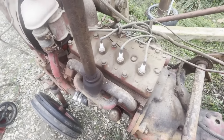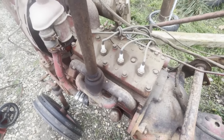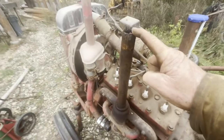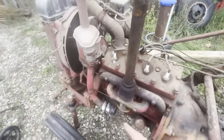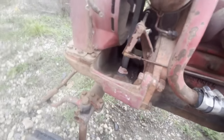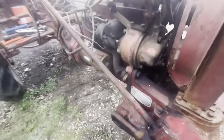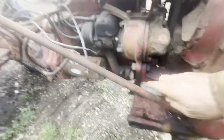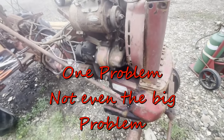She's got a cracked head right here. Well, that's too bad. I don't know if we can repair that or get a different one. That's why we poured diesel fuel in through the exhaust pipe and it actually went inside there. So this is all pretty screwed up — diesel fuel ended up coming out of the radiator, probably through the bottom radiator hose. Goes through this casting right here. So right away, we've discovered our problem.